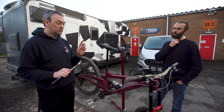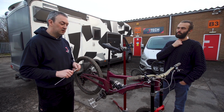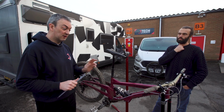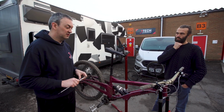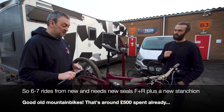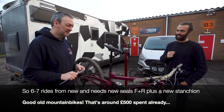We've also used an additive in there that we use on all our stuff, which uses Teflon particles that are micro ground and negatively charged. Works great in a lower leg. You'll notice quite a big difference on that. Yes, science. We also found a nice big piece of grit wedged in the bushing itself, which we've rectified.